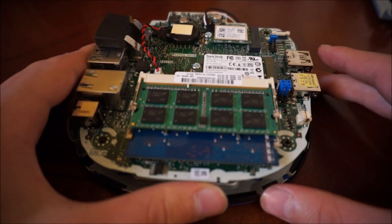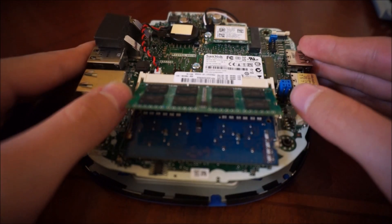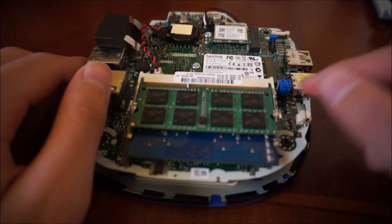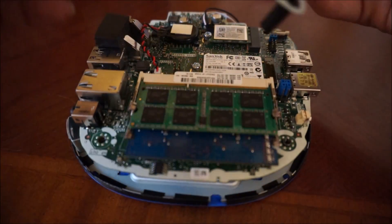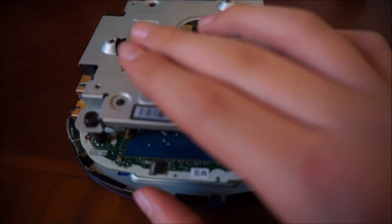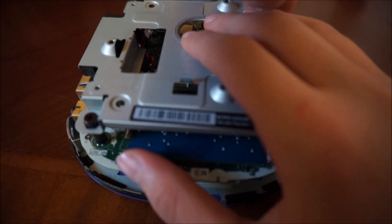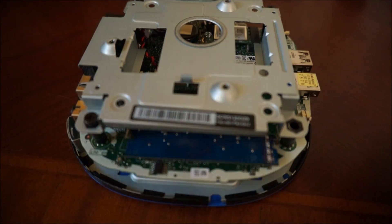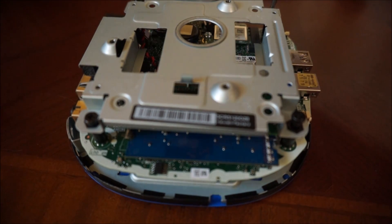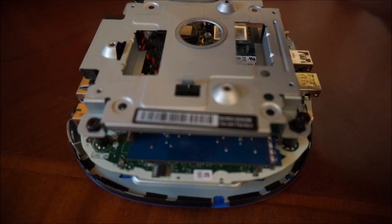I'm pretty sure the older Stream Minis have the pre-installed RAM on the top. What you want to do is pop it out by pressing these two clips, pull out on the bottom, press it down. Put in a new one and press it down like that. Remember the barcode goes towards us. Let's line up the screws again and screw these in — go diagonals. Not too tight — this is basically what's keeping the entire system held together.